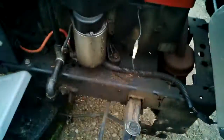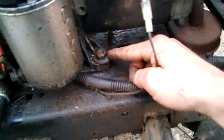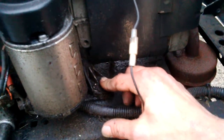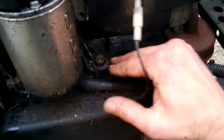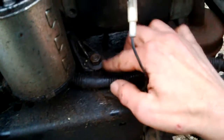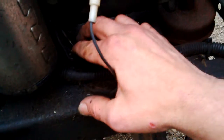When this thing came to me, the engine would shake and flop around — the exhaust had been broken off at where it bolts to the engine. I'll show you that. I ended up putting nuts and washers on the engine bolts because there were none. When I realized the engine bolts were still there but saw how loose they were, I was completely amazed they hadn't just fallen out — there was no good reason for them to still be sitting there. Luckily none of the actual mounting area was cracked or rubbed through, so I tightened the bolt, put the nut and washer on, and tightened it. I'd been nervous about the aluminum threads being worn, so I could give them a final tightening with the nut because I didn't want to torque too hard on just the aluminum thread in case I stripped it out. There were also a couple other stray loose bolts I noted and tightened — they all seem to be staying tight.